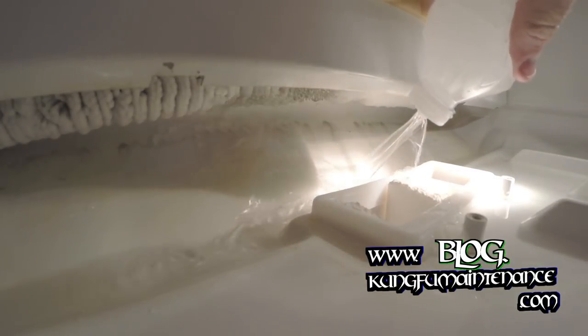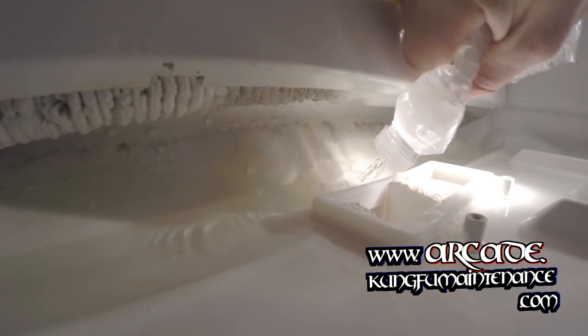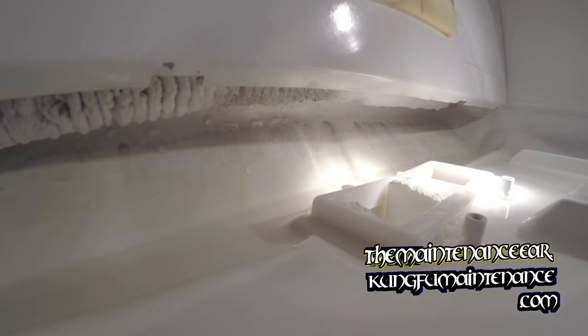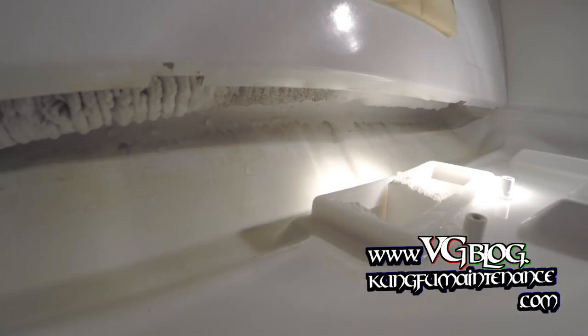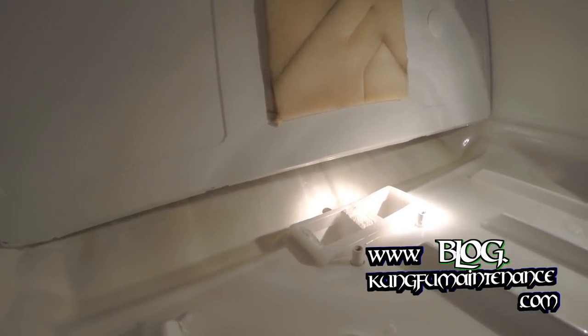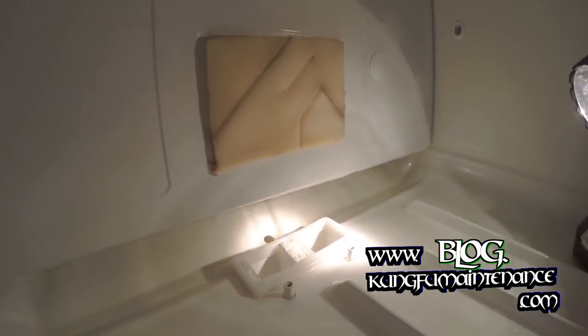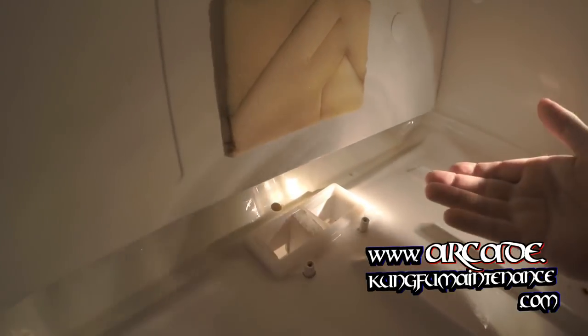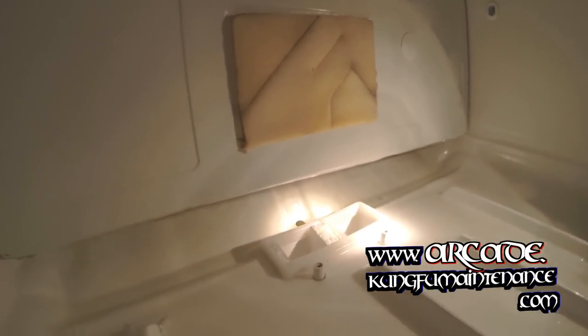Now that it's cleared, I'm going to add another round of hot water to really make sure — just aiming it in there and squirting it down. Now we're going to be sure, for sure. There it goes. This drains into a small pan that's on top of the compressor underneath the refrigerator. The compressor gets hot as it pumps the refrigerant through the tubing, and that heat helps aid in the evaporation of the condensate water that forms there.